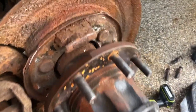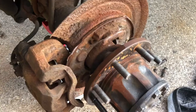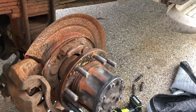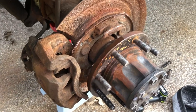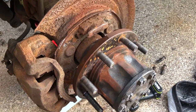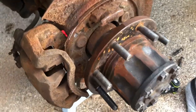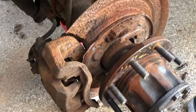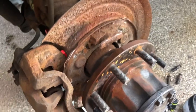We're on the back axle here. First things first, take out your parking brake — you do not need that. This thing's got 240,000 miles on it, and the parking brake was seized; there was no way it was ever going to come undone. Make your life easier — pull the parking brake shoes out, toss those in the garbage. Weight reduction, you don't need it.